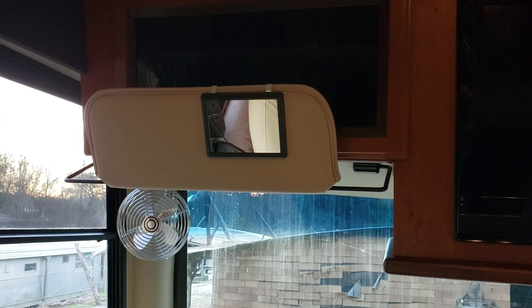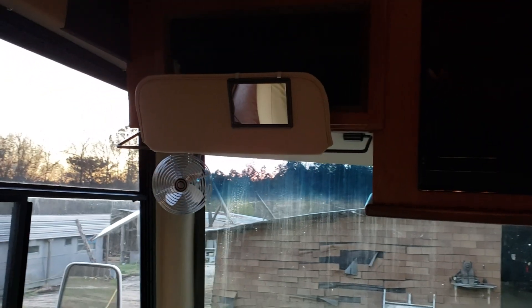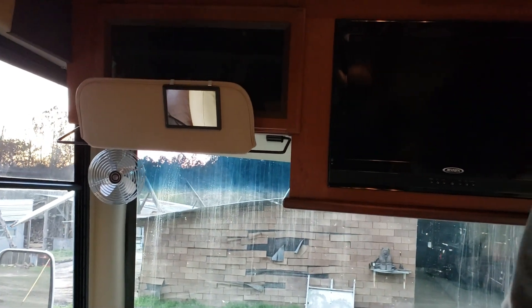It's also very important that when we start out — unless we just stop briefly for food or gas — she walks around the motorhome in one direction checking that everything is clear, and I walk around the other direction doing the same. Make sure the step is up, because if it hits something it can break right off. Thank you very much, hope you enjoyed it — goodbye!